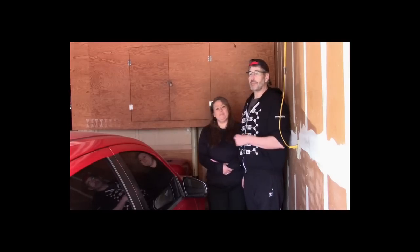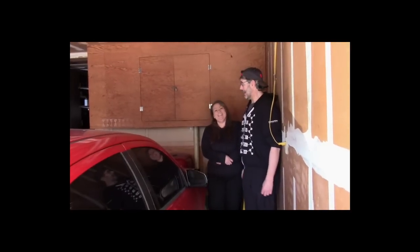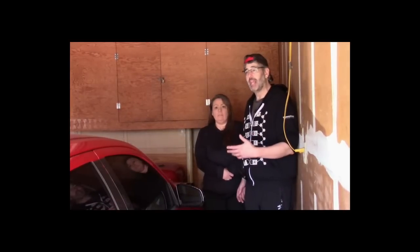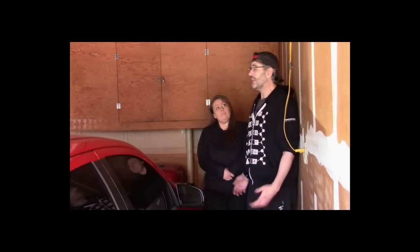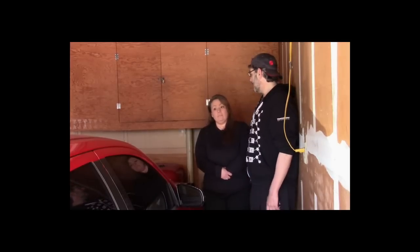Guys, I'm sure most of you remember Juanita here. Some of you really remember her. We're back with her to see what's going on with her car. Just a real quick update. You remember her from a video about 3, maybe 4 years ago. She had the car cutting out on her while she would drive. We were trying to figure out if it was the fuel pump, camshaft, or crankshaft position sensor. We never did get it to happen. It turned out it was a failing crankshaft position sensor. I fixed that years ago, but now we're back with something totally different.